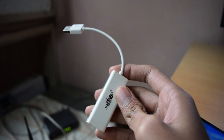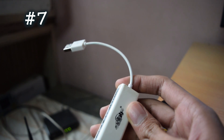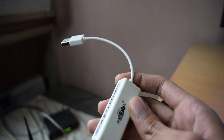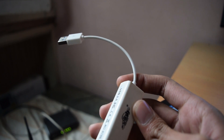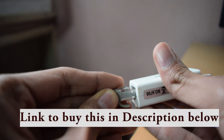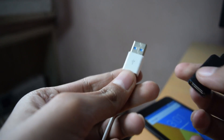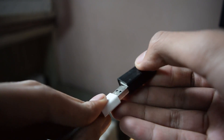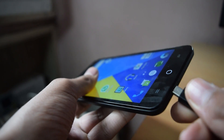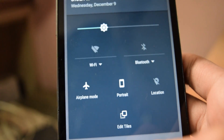The next on the list is a LAN cable. Yes, you can connect a LAN cable to your Android phone. For example, if you don't have Wi-Fi at home but you have a broadband connection, you need to buy a LAN to USB adapter — links will be in the description. It will cost you like $5 to $6, or 300 to 400 rupees. Connect it to the OTG cable, then connect the LAN cable, and as you can see the internet is working while Wi-Fi and mobile data are turned off.